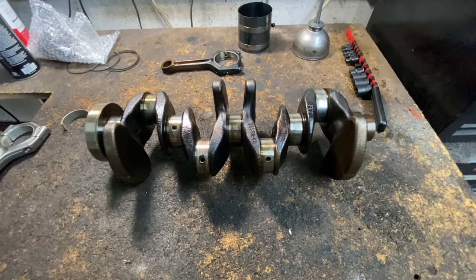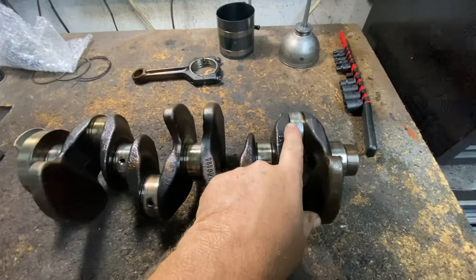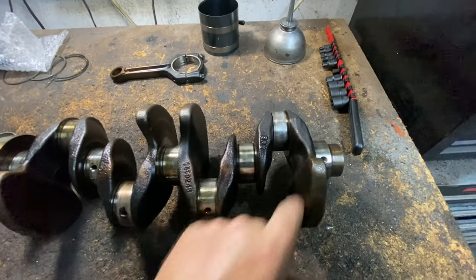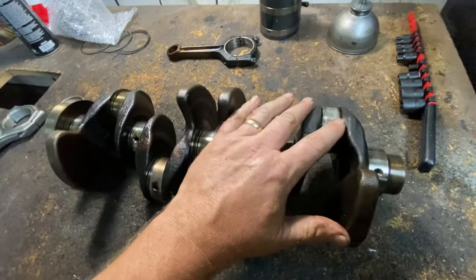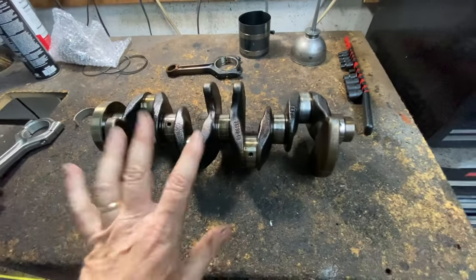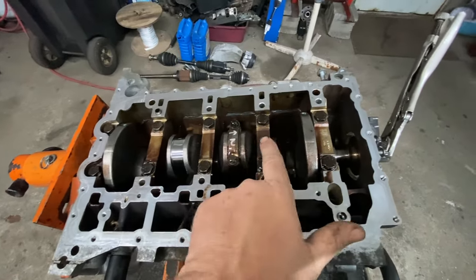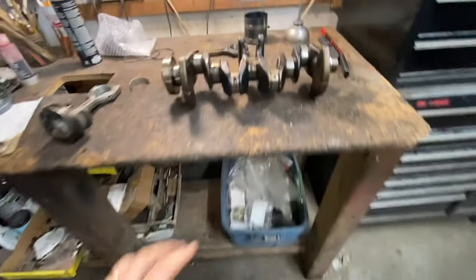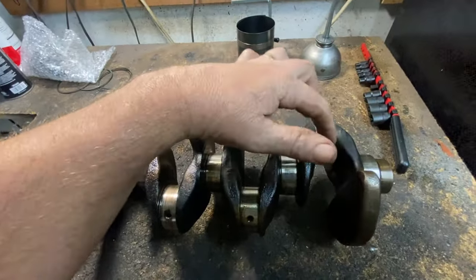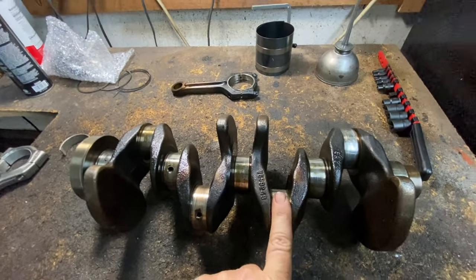Can you save an engine with a spun bearing? Yes. Can you fix a spun bearing? Well, you can't really fix it — once you take this off it's going to be scored. You would have to get a new crankshaft; it depends what kind of car, maybe the crankshaft isn't that expensive. Either way, it's a major engine job. You have to take the engine way down. What the machine shop would do is regrind it, if they can, to a lower spec and give you thicker bearings with the same bearing clearance as the regular ones.